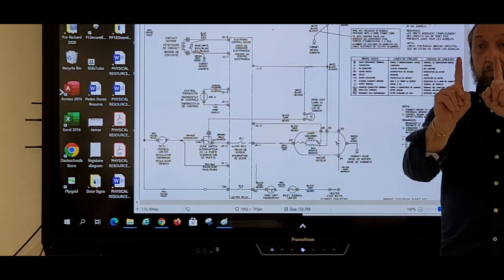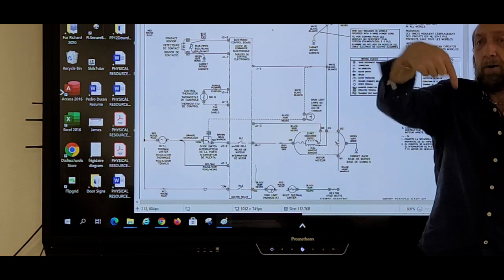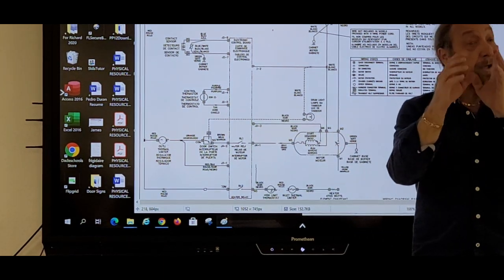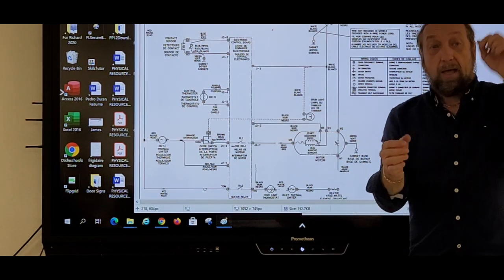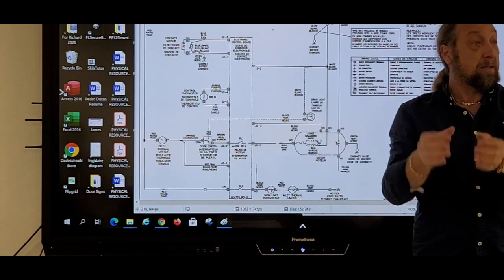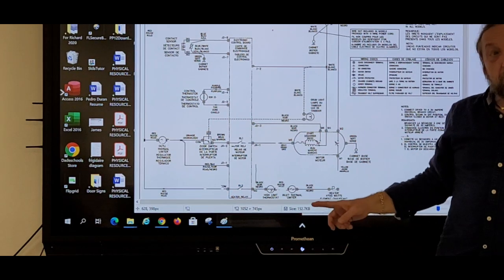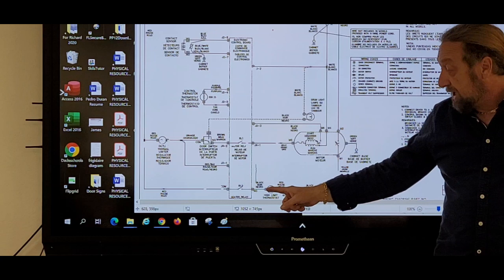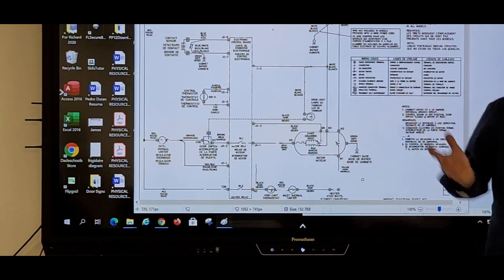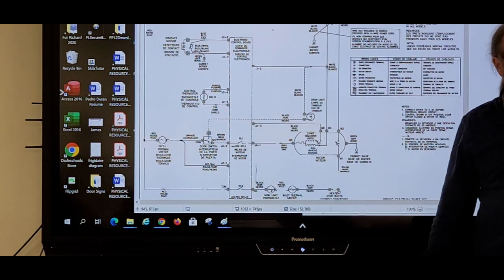most parts have two terminals. One is power coming in, the other one is power coming out. And you say, well, how do I know which one is in and which is out? How do I know if the power is coming in on this one and out on that one or vice versa? It doesn't matter. Because if you go to a part like a thermal fuse or a thermostat, and you've got voltage on one side of it and not the other, it is bad. It doesn't matter if the power is coming in this way and going out that way. If this is open, one side is going to give me no reading, the other side is going to give me a reading, and that is the bad part. But if I have voltage here and I have voltage there to ground with this disconnected, that part is good all day. Because I've got it coming into that thermostat, and then I go here, checking out of the thermostat, and I've got it right there.